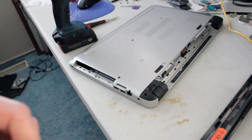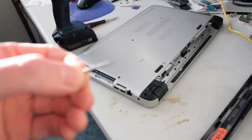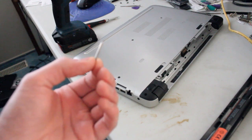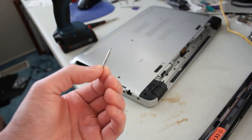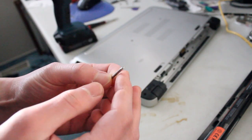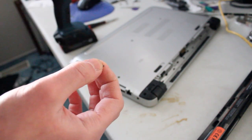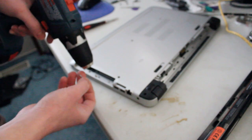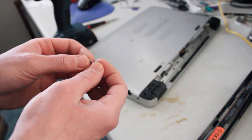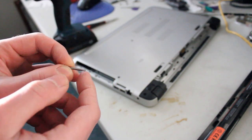always remember to keep your drill in reverse, and I'm going to focus in on the tiny bit here. Okay, one moment. Bear with me. There we go. So you want to start with the side that looks a little bit more like a conventional drill bit. Put your drill in reverse, press lightly, and just try to slowly edge the stripped screw out. If that doesn't work, you can turn it around and there's another edge that you can try.